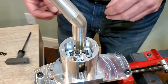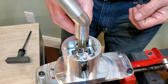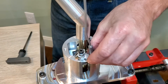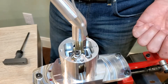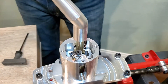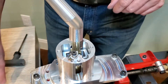We put two shims on each side and drop the spring down on top. You can also do two shims, one shim, no shims, or completely leave out the spring. If you do that, you want to take the button out and not have it installed at all. I'll demonstrate one side with two shims and a spring — very stiff — and the other side with no spring at all.